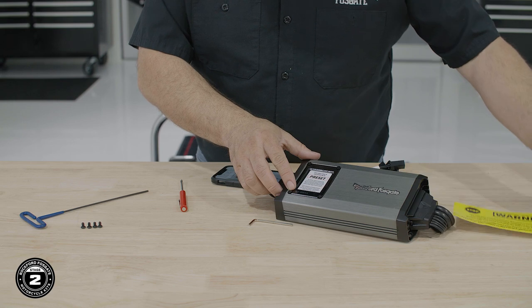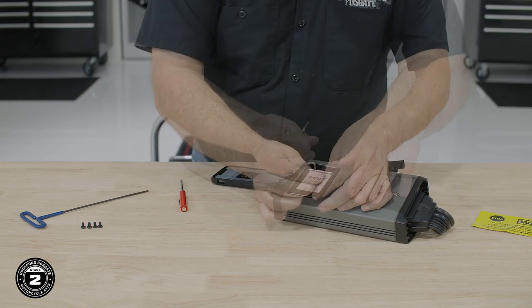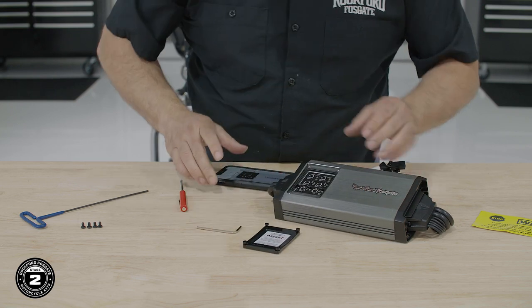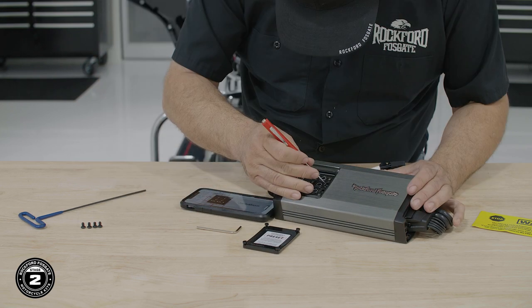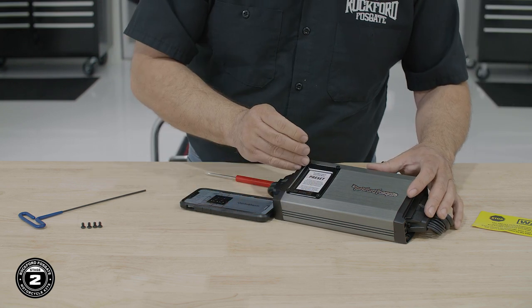We offer an amp tuning guide that's available in the description of this video and through this kit's product details page at rockfordfosgate.com. This process will be the same for both Road Glide and Street Glide. Use the included Allen wrench to remove the smoked control cover. Using the tuning guide as your reference, minimal adjustment should be needed to tune the amp. Once we're done, we'll reinstall the cover in place.